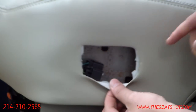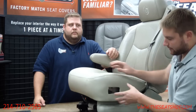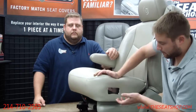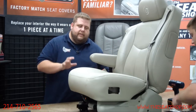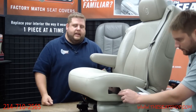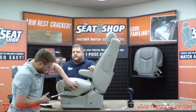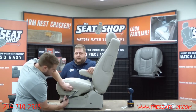The vinyl's up here with the foam down here — just trim that out. This way when you're sitting down on the seat and the panel's back on, you're not going to have the top or bottom lips from the compression pulling out of the side of the panel. You can always have a lot of extra overlapping vinyl still fold into that pocket when you screw the control panel back in. As long as you get the foam cut out, you're going to be in good shape. It's just going to be way too tight to get it back in there if the foam's still behind the vinyl as well.